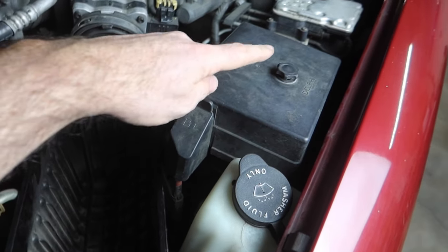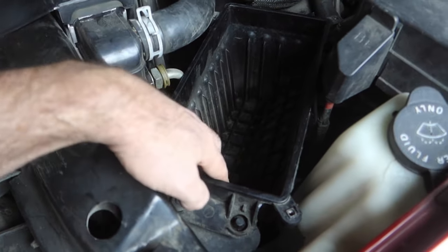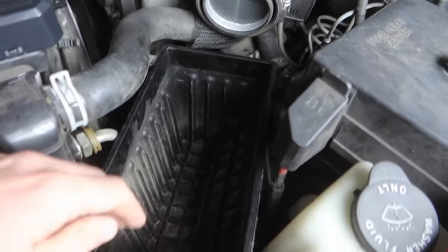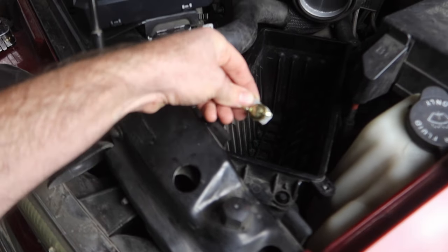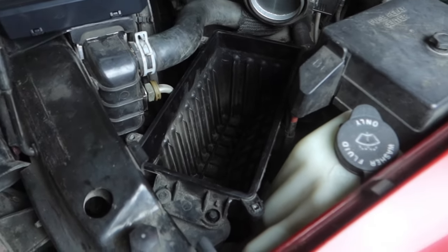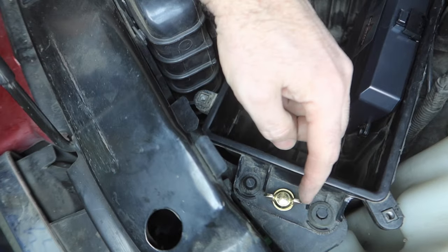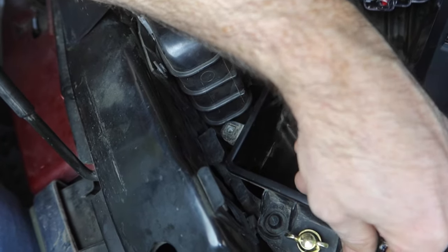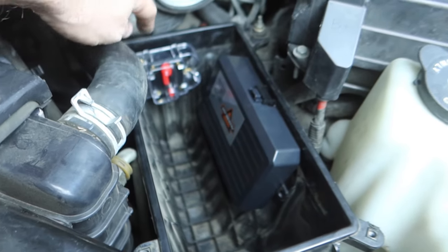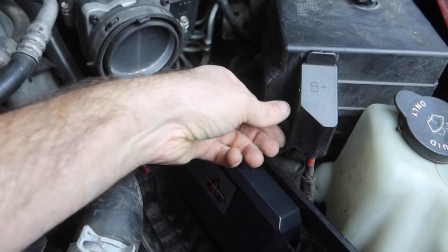I have battery positive right here, ignition power, and a fuse box right here — I've got everything I need to run this. A couple of things we need to do because this is kind of floppy and we're going to be putting weight in there. I found this little bracket here — we're going to drill through this and attach it where a wing nut will bolt down and hold this solid. It's still a little bit floppy even with that added because the mount just kind of snaps into the core support and it's kind of floppy. So when I make a plate that goes on top, I'll make a little tab that bolts to this guy right here because this is solid.